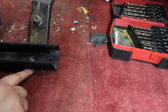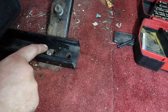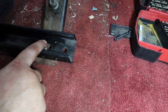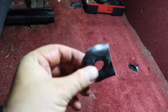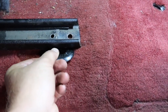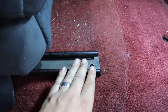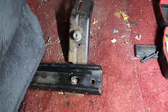Doing a little trial and error on the back side of the driver's seat bracket — we bolted it down with the nut on the original stud, which is nice and tight, but the hole is a little too small. The track needs to sit down on top of that nut, but we can't use the nut to fasten the track because the stud will come up too high and the seat will hit it when it goes back. So we're going to use the back hole instead. I took a little piece of the old seat bracket and roughly cut it off to see if it would fit as a spacer. We'll stick this underneath to space out the track so when we put our bolt through the floor and tighten it down, we have even spacing on both sides.